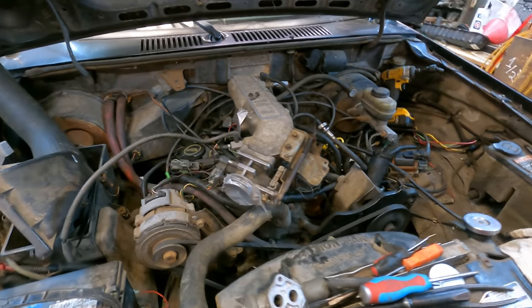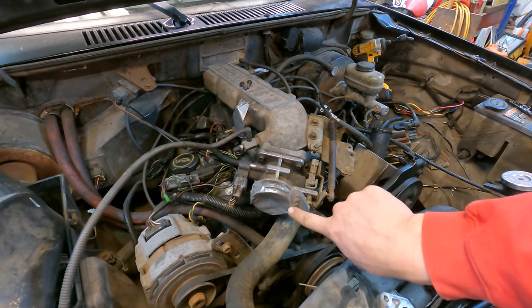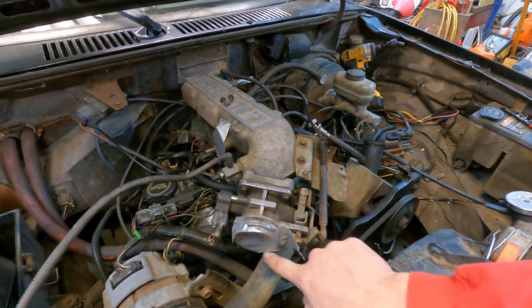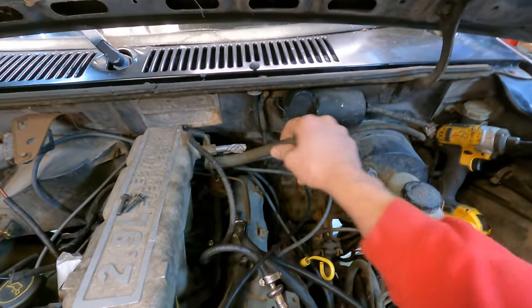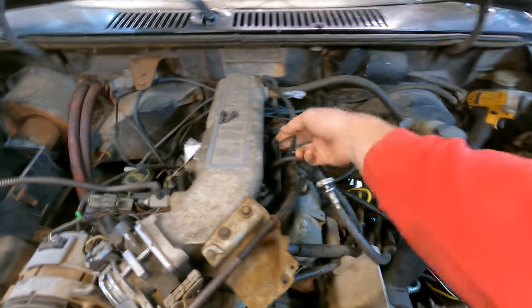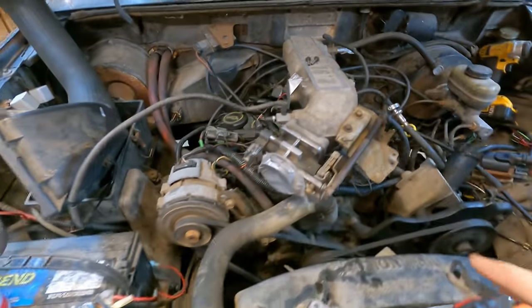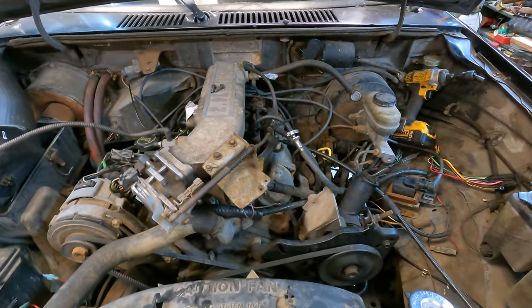because if it's sucking air from somewhere, it's gonna throttle up higher and higher. And what I found was I completely taped off the throttle intake idle air control and the big hose over here for the vac boost, and all these other little lines and stuff are connected how they should be. So it can't be any of those.